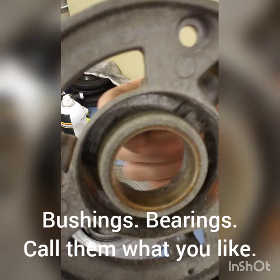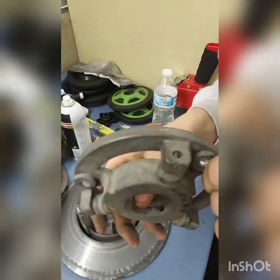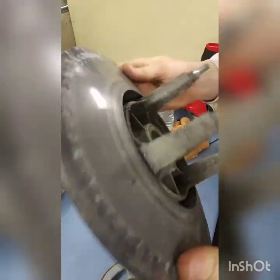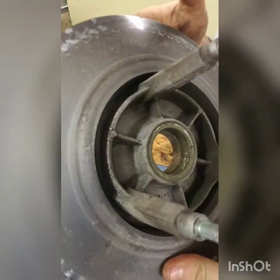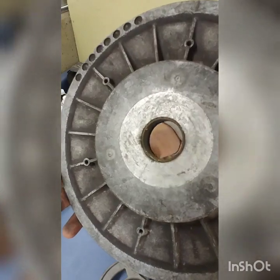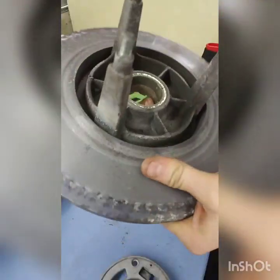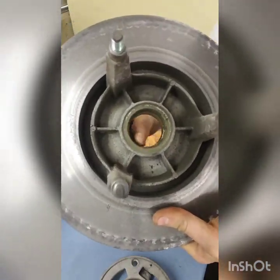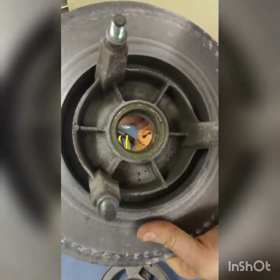You're going to want to check your bushings — these little brass bushings inside here, they're just pressed in. They're usually in good shape, but you don't want any major cracks or wear. There's one on the cap and one on the moveable sheave — that's the moveable sheave because it's got the bushing, because it moves. That one's a little rougher but it's going to be good enough.